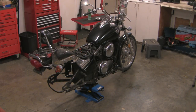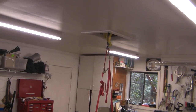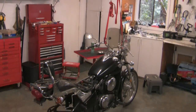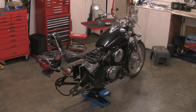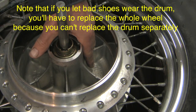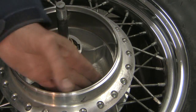While I'm getting the new tire on the rim, let me show you how I've got this balanced. It's almost like a tripod with supports on the handlebars holding it up so it can't possibly fall. You can see the blue stand the bike is on, and through the trap door in the ceiling I've got a 4x4 across the studs going laterally - that's plenty strong, reaching down to the handlebars. Almost all manufacturers print their maximum drum diameter inside the drum. Now that we've cleaned it off with brake cleaner, we can see the maximum diameter is 180.75 millimeters, and we're clearly well below that limit and it's nice and round.